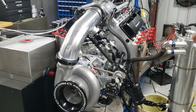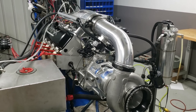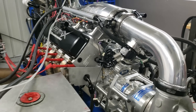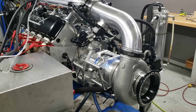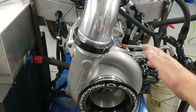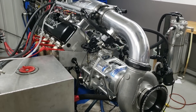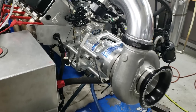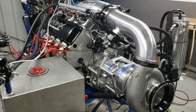Before everybody gets super excited, we will do a little bit of back-to-back testing because I actually have an identical motor for a different customer, Derek Ornelas, that is going on the dyno next — identical engine but with a 136 blower. Just because the blower is bigger does not mean this thing is 200 or 300 horsepower better. That's not the way it works. The question is: is it a better, more durable blower? That's what they've been trying to prove out in Pro Mod applications. Derek's not a Pro Mod car, so that's why we have the 136 on it.